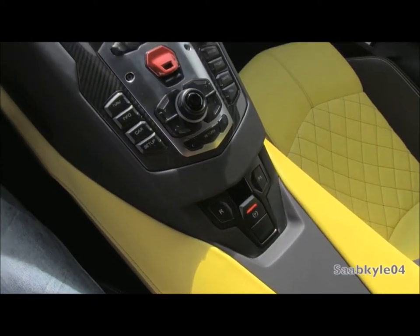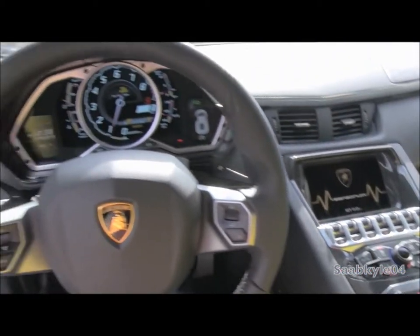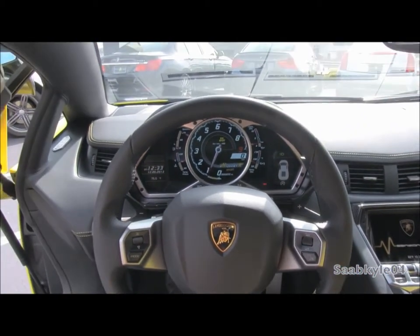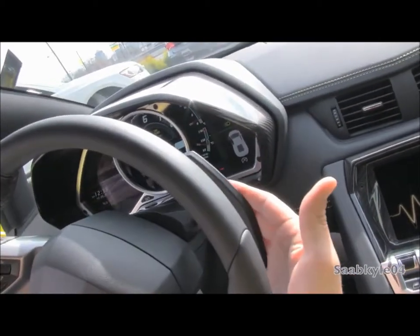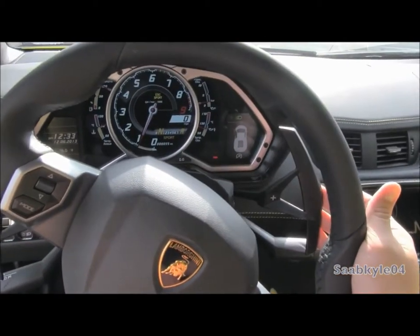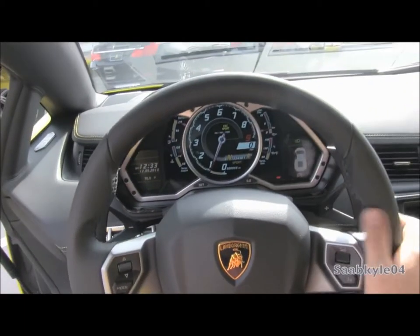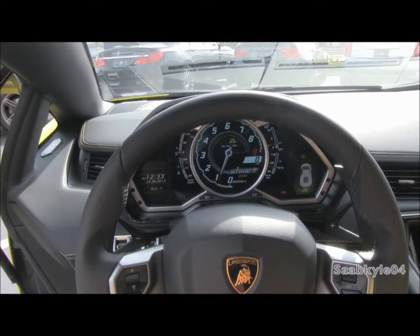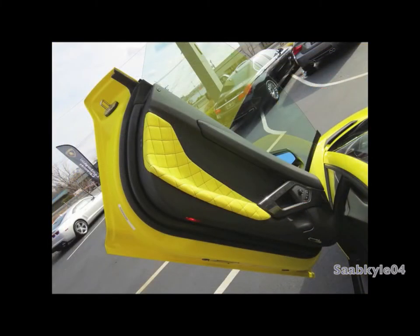It's a single-clutch, 7-speed automated manual gearbox that's not only said to be lighter than a dual-clutch setup at around 154 pounds, approximately half the weight of a dual-clutch gearbox, but it also retains lightning-fast shift times as low as 50 milliseconds. In comparison, F1 cars usually have 40 millisecond shifts. It does this by prepping the gears around the one that you're currently in. In other words, it simultaneously disengages one gear while engaging the next by using twin shafts and 4 carbon synchros.